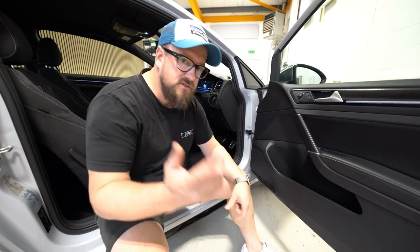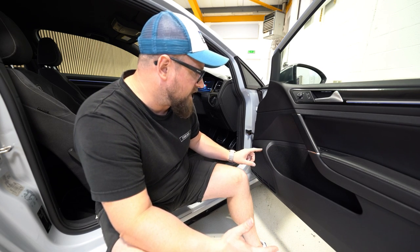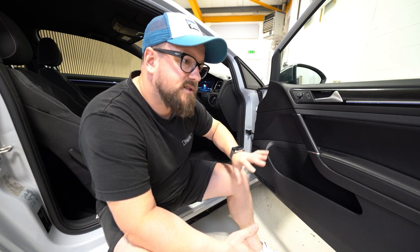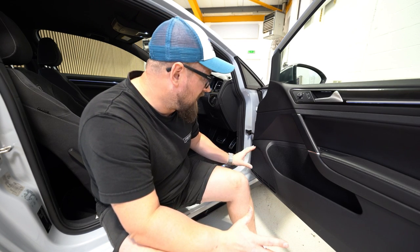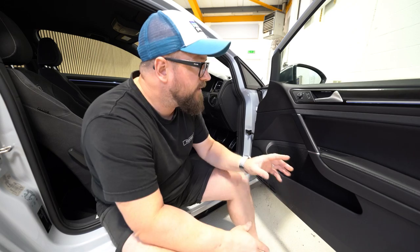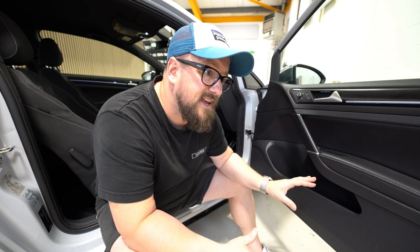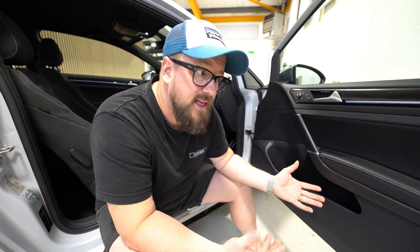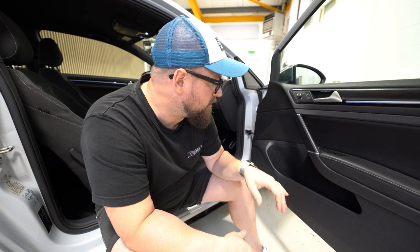Around the front - since the last time we spoke you haven't seen this - we have installed the C7 mid-basses in the doors. The doors are fully deadened, inner and outer skin, we took the inner skin off - everything as full-on as you can get it really without interfering with the door itself. My long-term plan is to remove this grille, kick that speaker around and rebuild the grille somehow. But we don't get tons of time with our own cars, so we had to get the mid-bass in there as well as we could. To be fair, the factory mid-basses were doing an all right job with that much power behind them - we wired them in just to get some mid-bass off the ground while we did the mid-range and tweeters.